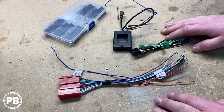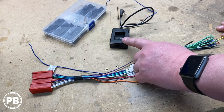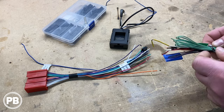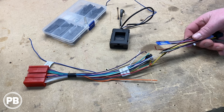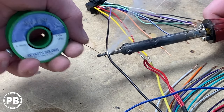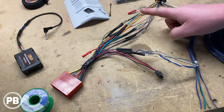To start prepping the wiring harness, we've got our Crux module out of the box — it retains steering wheel controls, and we'll have an unboxing link in the description. Then we have our Pioneer radio wiring harness, which comes with the Pioneer. The wiring is similar so you can match color to color — about 90 percent of the time it's just plug and play. You can connect wires with butt connectors or crimp caps, but today we're soldering our connections for a solid connection. After soldering we'll move our heat shrink up over the connections and shrink them down with a heat gun.